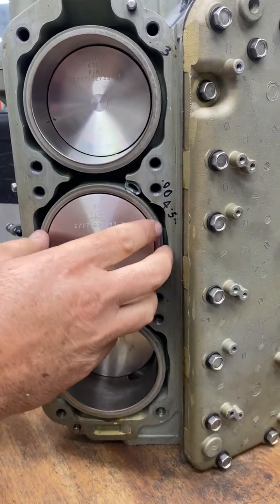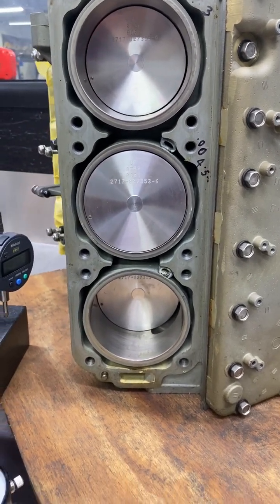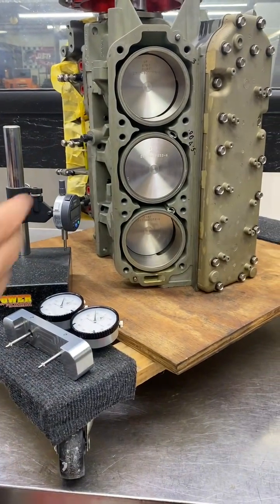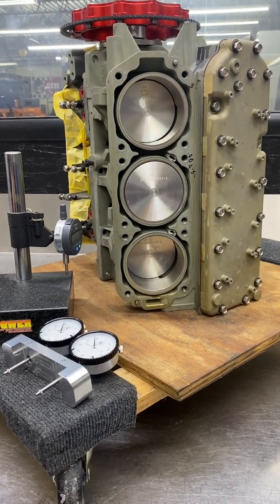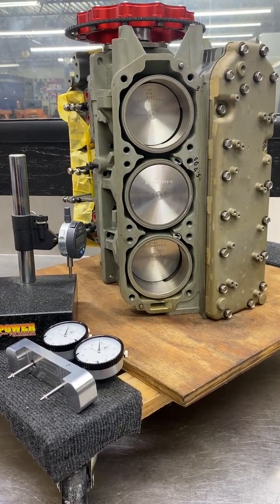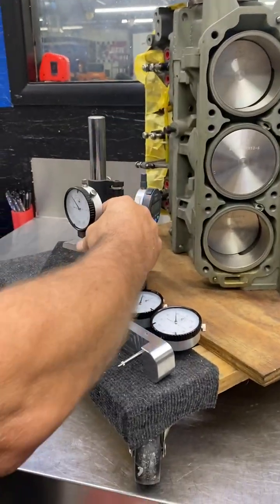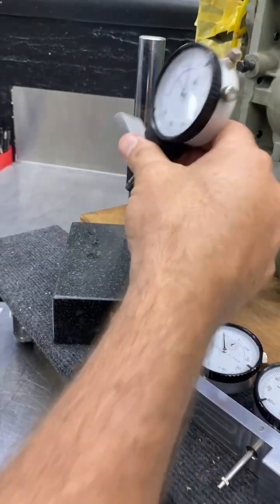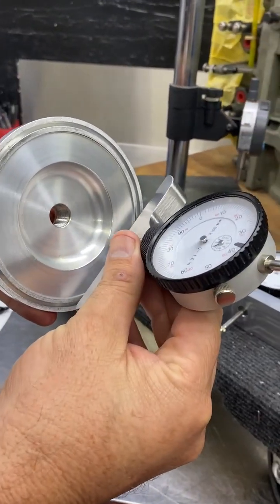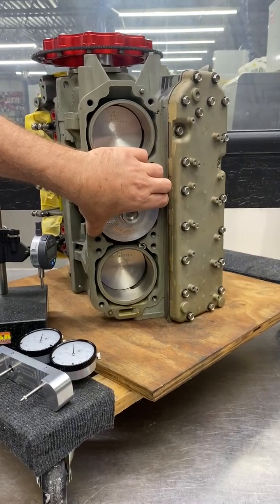So we have a positive stick-out here — you can feel it's barely sticking out four and a half thousandths. When we actually go to machine the chamber, we machine the chamber specifically for each cylinder to optimize the squish. Ideally, if you're drag racing you want 36–38 thousandths squish; if you're lake riding you want about 40 thousandths squish. We use this gauge here, which is also zeroed — this isn't part of the kit but it's what we use internally as we machine these. We sit it in the corner of the chamber and that reads 44 thousandths, so on this lake motor this chamber would fit perfect and optimize the squish at 40 thousandths.